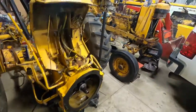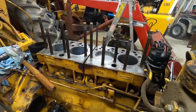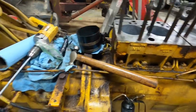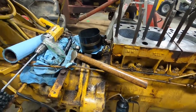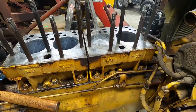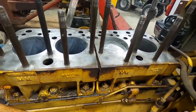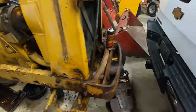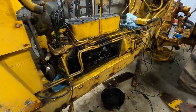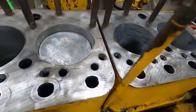What I did on the tractor itself - excuse the mess in here because I've not been around much - but tonight we've got the first two pistons in and we'll film putting the other two pistons in. I basically got a ball hone and honed out the cylinders, got a nice crosshatch going in those. I cleaned up the whole top surface here for my head gasket when I get to that. You can see in the first cylinder there, we've got the pistons in.